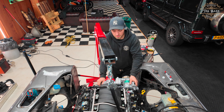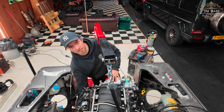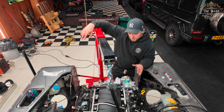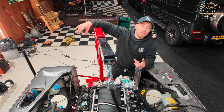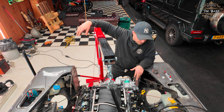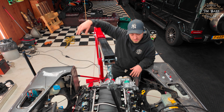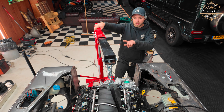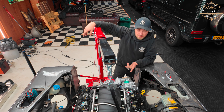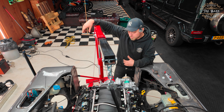It's taking a little while to get it level and centered, but now I have the engine mounts down here. On this side I will tack them in place with the engine here, and then I'll need to pull everything back out — undo everything I've just done — weld the supports in completely all the way around, then put everything back in so it can be mounted for the last time. But before I put it back in, there's still some cabling that I can pull out that doesn't need to be there anymore. I'll also do a general cleanup of the engine bay, because once this is back in there are parts I won't be able to reach, so I'll wash and clean everything down for the final time.